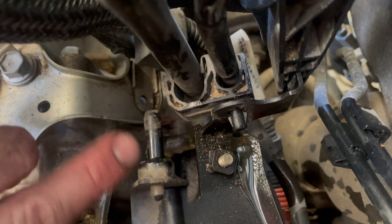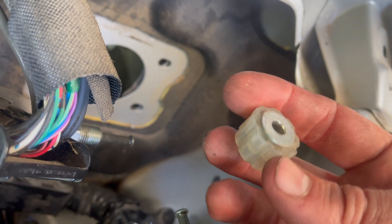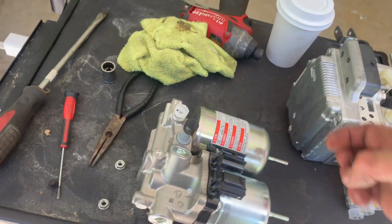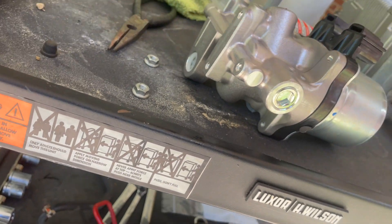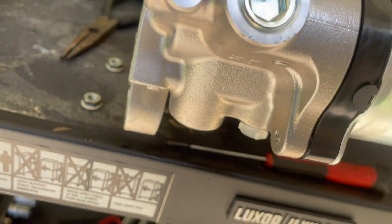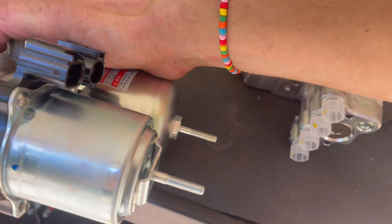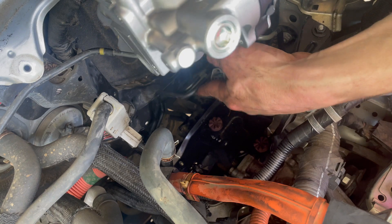Recycle it. This piece here is fitting on one side — the other two bolts slide into this hole and this hole, and there are these little rubber pieces. That's what it goes in, slides in, and then it tightens down with that 10 millimeter. Looking at it outside the car, we have this piece that essentially — if we imagine this as the barb going out — we have to put it in, slide it over so it's secure on that side while these are going in the other two holes on the right side. I'm going to try a different approach where I put these guys in first. Got it in.